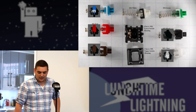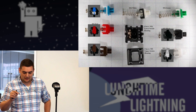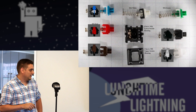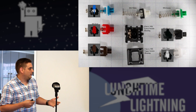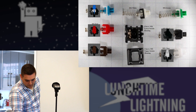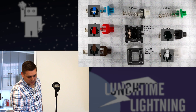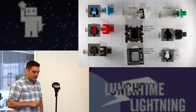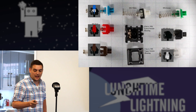The red switches are 45 CN — a much lighter touch. Their feel remains constant through each up and down stroke and they're popular for gaming because they're very fast, though you can accidentally activate keys. That's why people more interested in keyboards for typing won't pick a red switch right off the bat. The brown switch is 55 CN — halfway between a typing and gaming switch. They have a soft tactile bump about halfway through the key press, a softer click when depressed, and require less force to actuate than the blue switches.